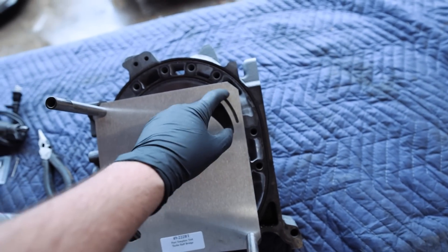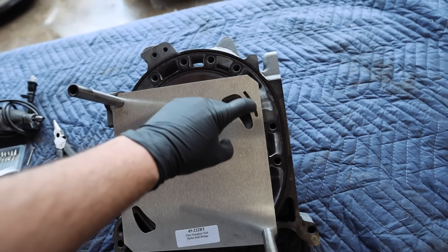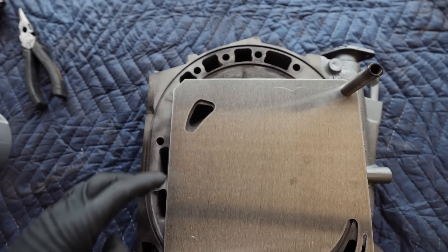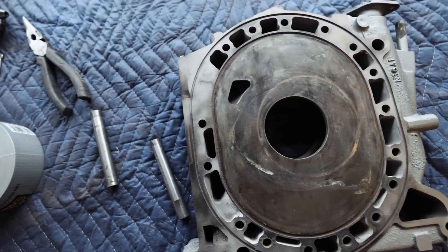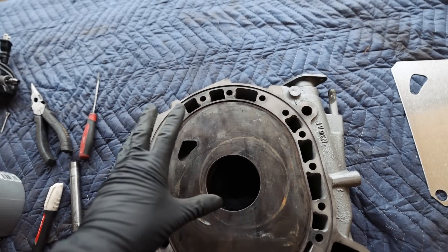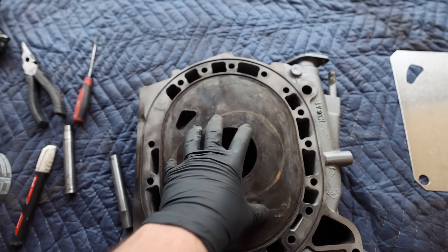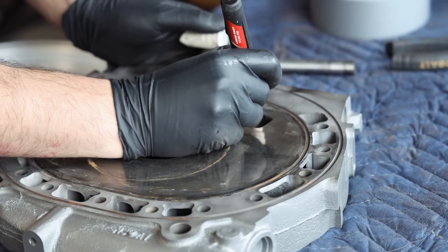The actual bridge portion goes on the front and rear part of the irons. The part without the bridge goes on the center iron. We're going to start with the middle iron, which is set up right now. This is how much it's going to open up — it doesn't open up a crazy amount. This is considered a street port and a half bridge. I'm going to pull these dowels off, get this plate out of the way, paint this whole area with a paint marker, then put our half bridge template back on and scribe it. Once scribed, we'll mask the whole area with duct tape to protect the sealing surface.